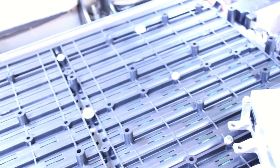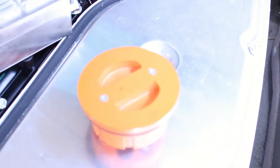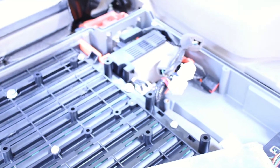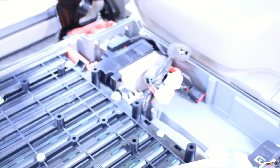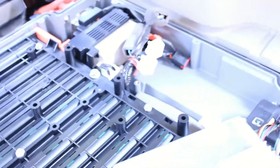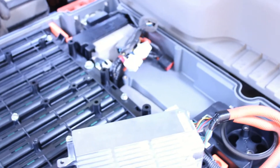With that safety fuse pulled, it's disconnecting the positive and negative terminals. So when you get up here to these electrical connections, the safety plug needs to be physically removed so these connections aren't live. Even with it removed, I'm taking extra precautions not to connect or short circuit anything. Use insulated tools, pull one screw at a time, set it aside, no jewelry, no wristwatches — you're working around high voltage electricity and if things short out it's very dangerous. Injury, death — know what you're doing, be very careful, and keep your work area clean.